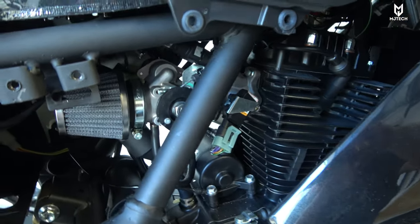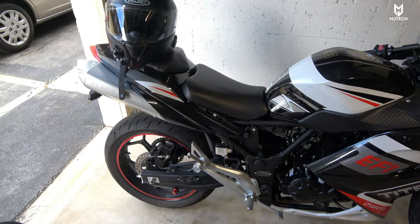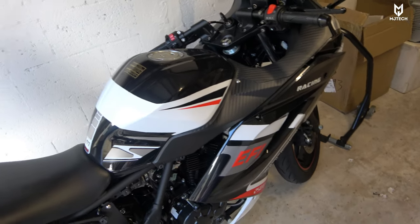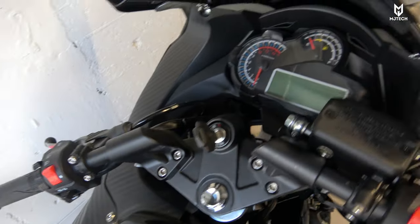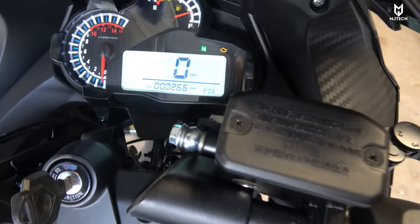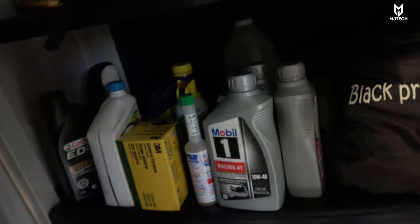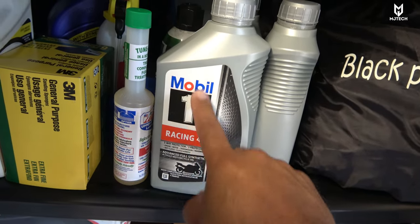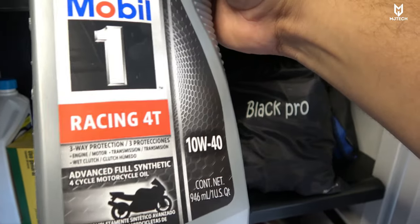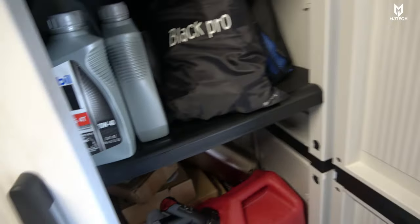So yes, this is what I ended up doing to the bike to make it run smoother. The brakes are squealing already so I will have to see what brake pads fit — hopefully on a separate video I can show you guys how to get that done. Right now this bike has give or take almost 300 miles — 266 miles on it — so at 300 miles I replaced the oil. It has to be 10w40. I used Mobil 1 full synthetic and it works like a charm.